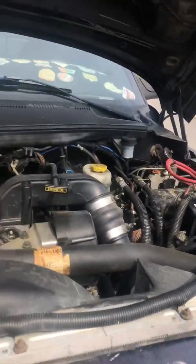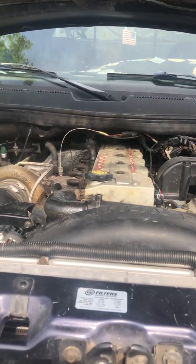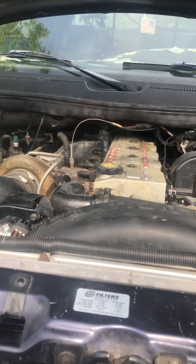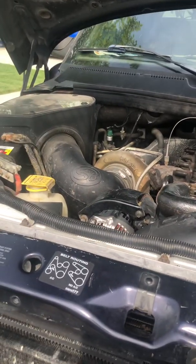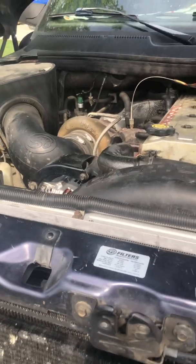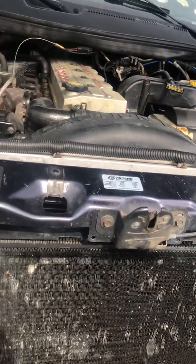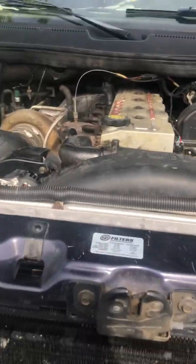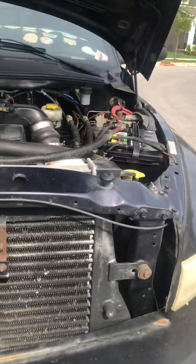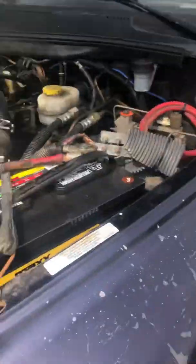What it is: you've got broken cells and a PCM that's reading these batteries as not having enough charge, then trying to force it through. It's a nightmare when it happens. What I personally did — since I knew I had run 16 volts through them for a bit of time — I pulled the batteries and the alternator and hit all the parts stores. The alternator tested bad; the diode machine confirmed the diodes were faulty. The batteries were load tested and they failed miserably — both had dead cells. Replaced those and the alternator, hit the key, fired it up, and everything's charging as it should with no additional problems.